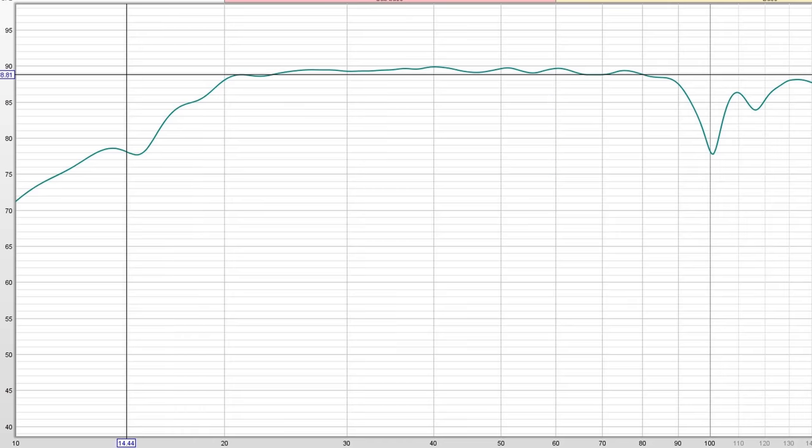On the low frequencies we're hearing the room resonances; at higher frequencies we're actually hearing the speaker. It's also difficult to get good measurements of higher frequencies. That's also why we measure not just one spot but a sweet zone, because it gives a more accurate representation of the room's resonances. If you use their tutorial, it's literally just doing a few measurements, clicking through settings, and you're done. I got a very flat frequency response almost all the way across — I do have one issue at 100 Hz which is literally my room and almost impossible to correct with speakers.